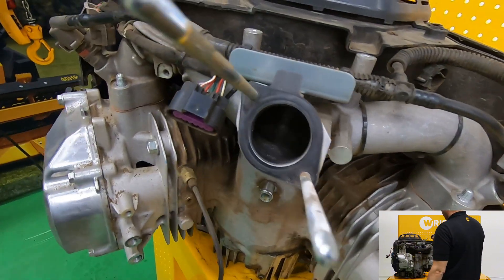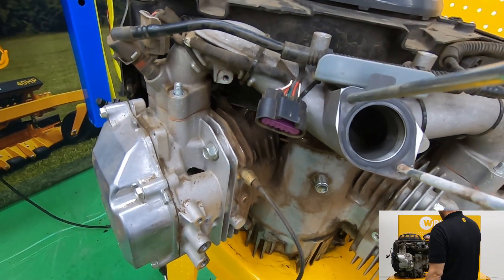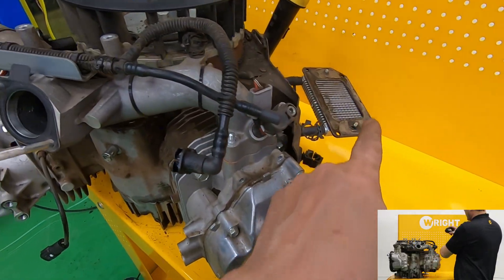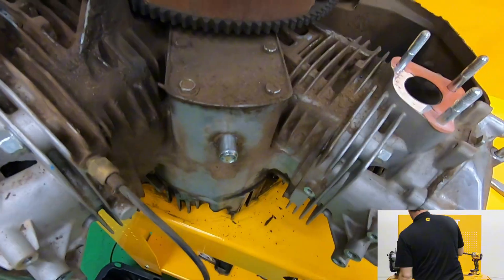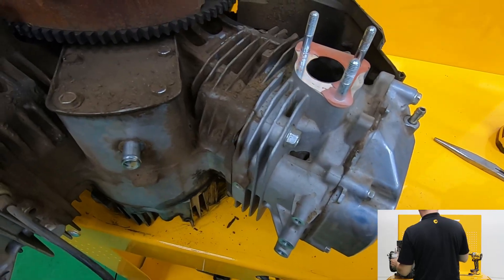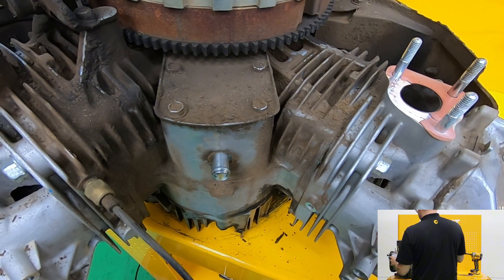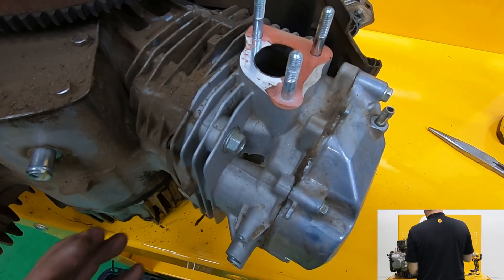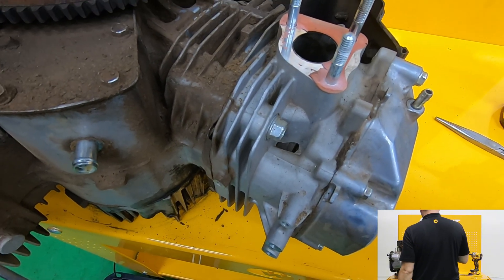With the front of the engine taken off, you can see the fins and the cooling. We've removed the main housing from the engine, pulled back the oil cooler, and pulled down the starter. Here we can take off the intake manifold. The layout of this is all very similar to the FX850, but when you get into the head and up is where it all changes. You can see the port here is on the top instead of in the valley. From here we're going to dig into the head and show you some of what makes this engine unique.